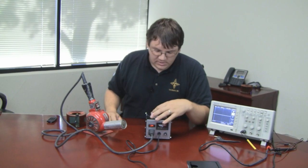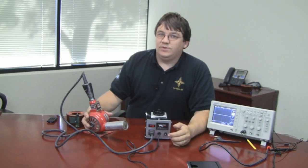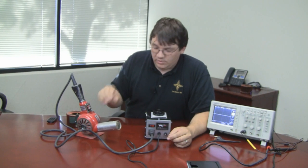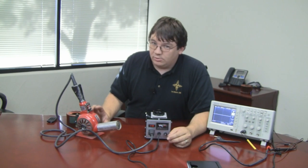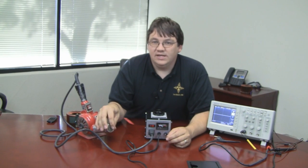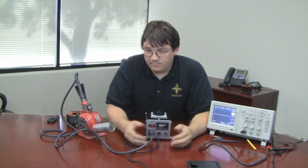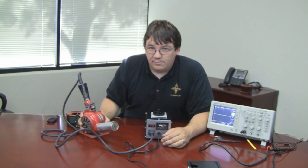With the heat gun, that's the primary example — but you can run fans and all sorts of other devices with this. The way this is actually functioning: inside this heat gun you have two things — a brush-type AC motor and a resistance-based heating coil in the front. Brush-type is important to note, as it means there are brushes in contact with the rotor that transfer power. Standard induction-style or shaded-pole motors don't work quite as well. When you lower the voltage going into a resistive heat coil, the heat produced goes down — so by varying the voltage with our variac, we can very precisely control the heat output.